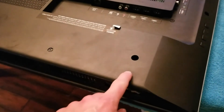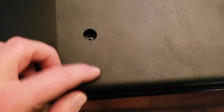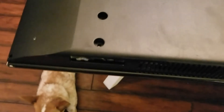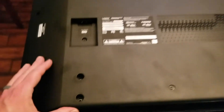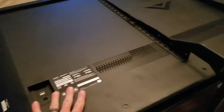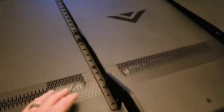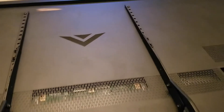If you don't have these aftermarket stands, most likely you'll have the original stands sticking out on each end — just a couple of Phillips head screws you pull out and the stand comes out. You need to remove those so they're not embedded into the metal on the TV, because we are going to be taking this entire back piece out to access the old board. So let's go ahead and remove all these Phillips head screws.